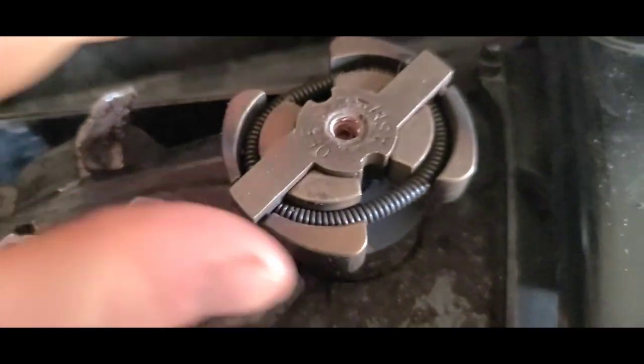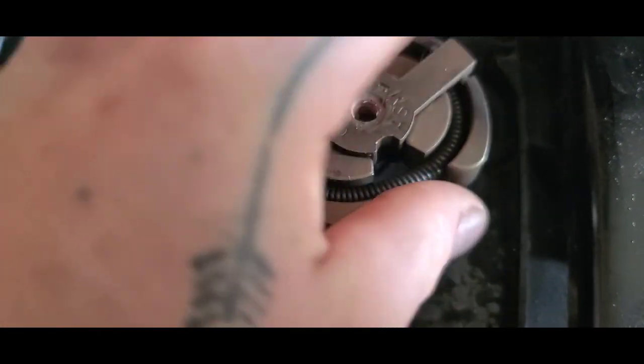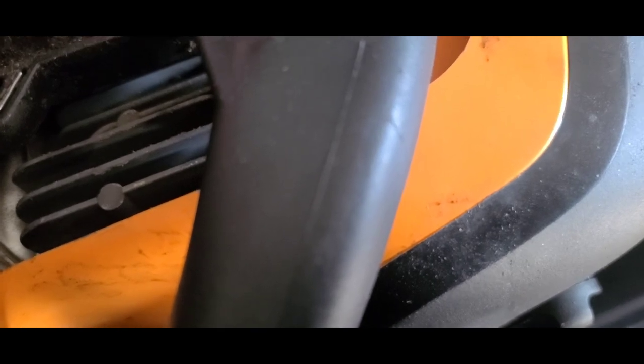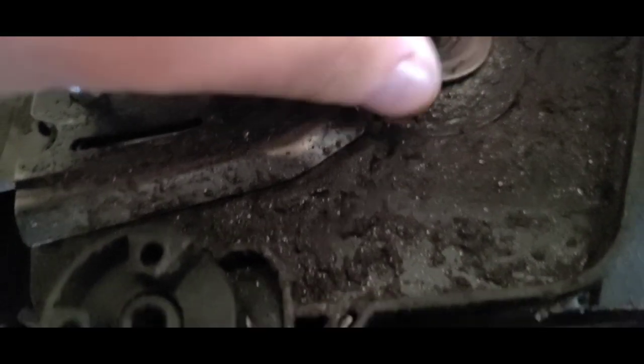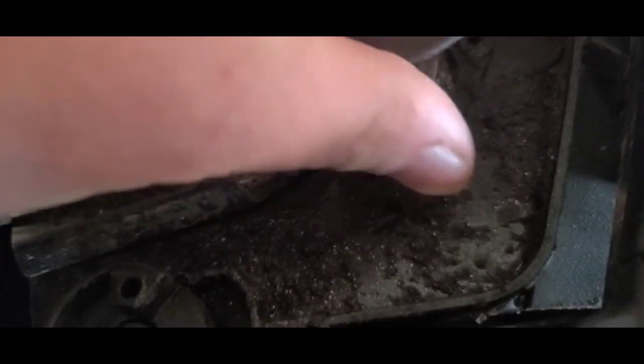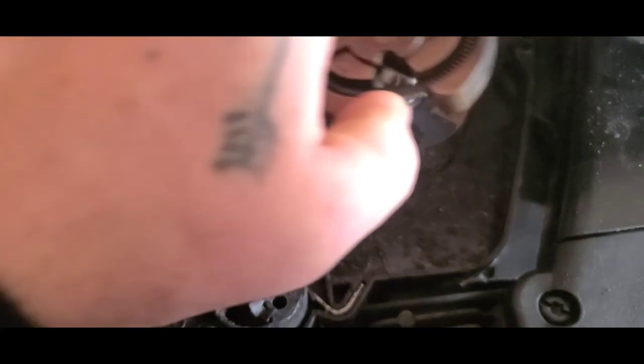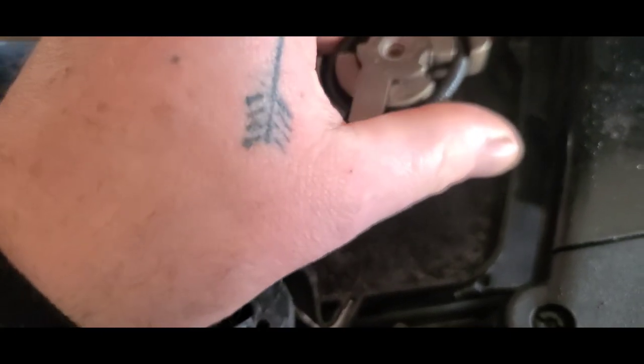This is what we're dealing with. Here's your clutch — it comes off reverse thread, and you can see they had some Loctite in there that we had to break free. To do that we had to put a string in, or they sell piston stops. Now there's two washers here — we're going to clean up all these shavings. This washer goes at the bottom. This washer goes with this side touching where the clutch moves. This was down against the clutch drum and sprocket — it's all one piece. So the clutch drum and sprocket will go on, then this will go on, then the clutch will go on, which we'll screw on opposite the way we normally would — reverse thread.